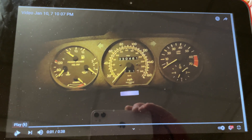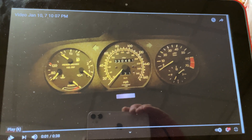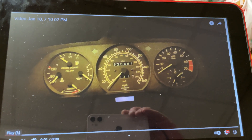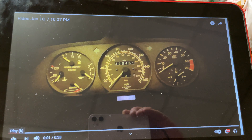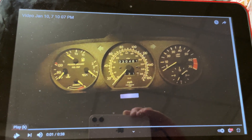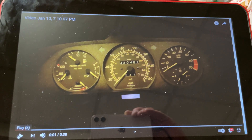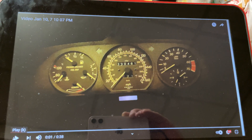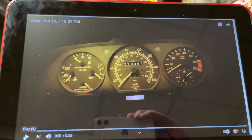I have the EZL coming for the 560 — actually the one which belongs in here — so my timing is going to be correct. It's possible this problem resolves itself when the correct EZL is in there and the timing stabilizes. But at this point it looks more like an issue with the idle speed control, because you can see it controls up to about 1,000–1,100 RPM — that's normal — but then it drops off too fast for the temperature. It should stay up a little bit longer and drop off more slowly for a smoother cold idle.